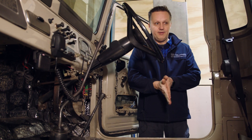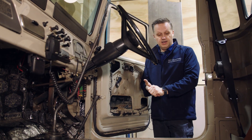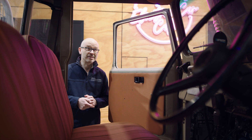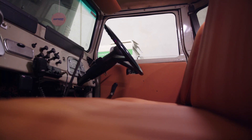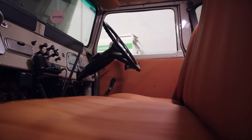Here we are at the interior. For those who've been following us, we have some of the trim back — the door skins are on, there are a few trim clips missing so we just need to get those to mount them on the door. The customer is ordering some door hardware. The sound deadening is complete, and once we put the floor lining in we'll be able to start reconstructing the interior. It's actually looking pretty good in here. This may look like leather but it's not — it's actually high-quality vinyl. The customer had heated seat pads installed, and the door panels and sun visors are done too. We've only got a little bit of tidying up and the head unit to go in.